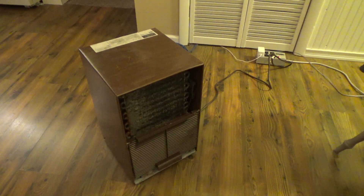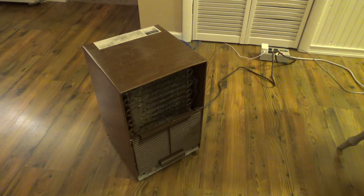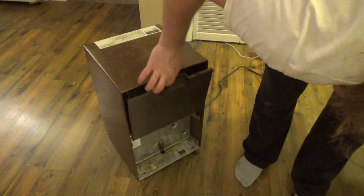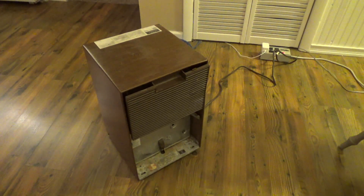This piece of equipment is in good working order. It's going to need serious cleaning, and I'm going to have to figure out something to do with the collection unit. It really just needs something to sit here and catch the condensate, and then I can funnel it into a condensate pump. I don't really want to be emptying buckets all the time — I'd rather do a continuous drain. I have the connection for the clothes washing machine down there, so I could put a condensate pump into that and never have to empty it, which would be ideal.